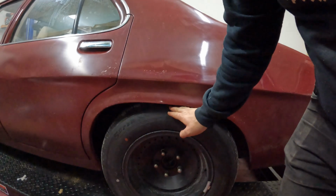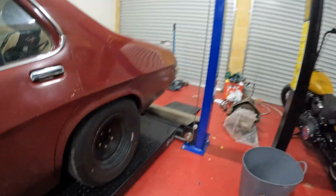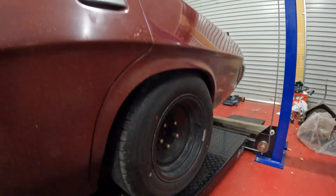I'd like to say the suspension has settled in a lot more. I'd say it's come down about 10 mil. It hasn't come down that much, I don't think, but between 5 and 10 mil, I'd say it's actually come down over the tyre. So that's suspension. Our springs that we got done, not the ones that I did and messed up, the professionally lowered springs, the properly done ones, they've started to settle in. So it's actually brought the car down. It sits good. It's tucked them tyres up in there, and look, we're happy with it.